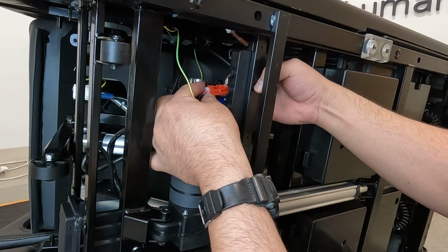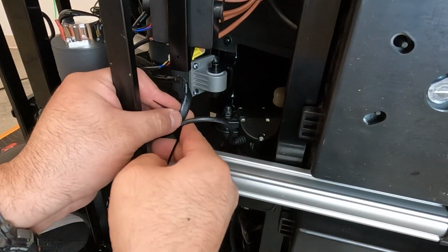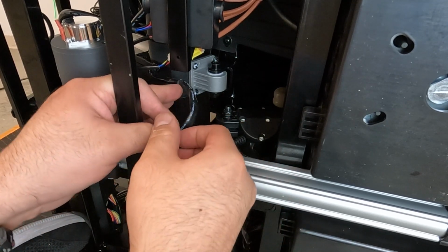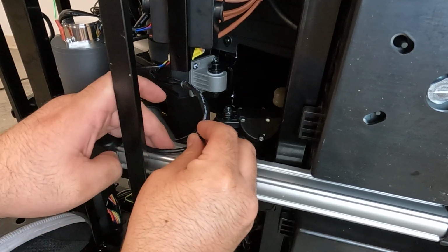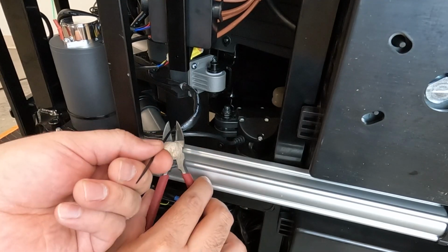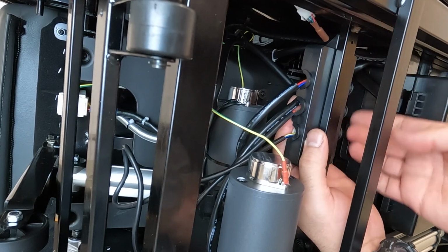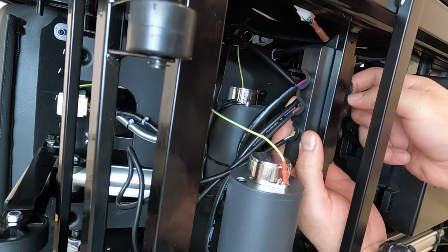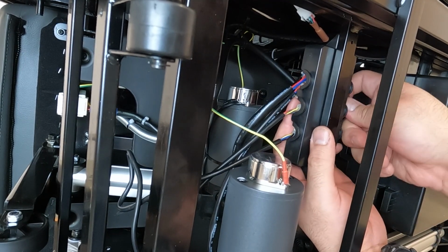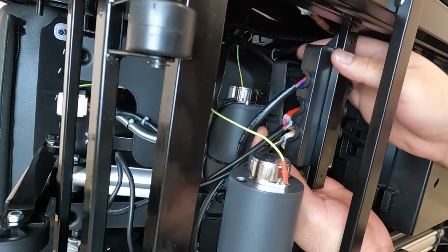Connect the red connectors. Replace the zip tie to secure the actuator cable to the other cable. Cut the excess zip tie. Organize the cables so they are all seated in the notches on the base of the junction box. Snap the junction box cover onto the base, making sure no cables are pinched on either side.